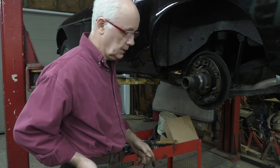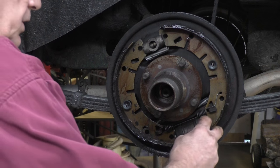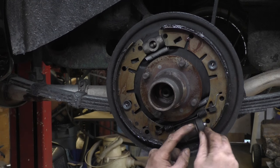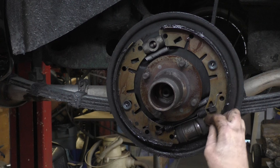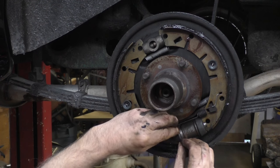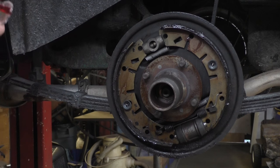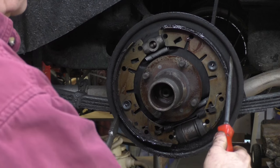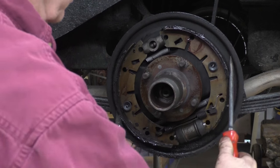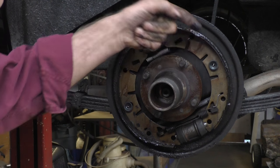If you're really adventurous you can taste it because there's a distinct taste to gear oil. Now the other thing we check for is on the wheel cylinder — if you look down here we've pushed the rubber back, you can see it's perfectly dry. And it's dry in here so you know the cylinder isn't leaking. You push it backwards and forwards and you can see the cylinder isn't seized up either.